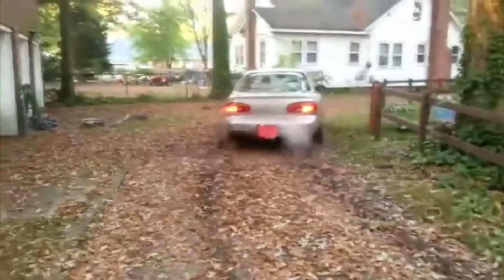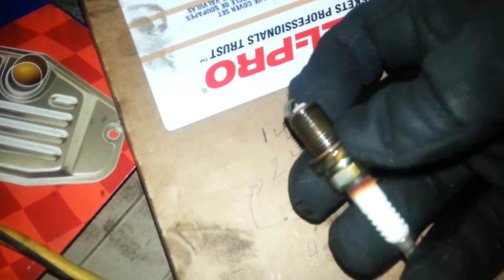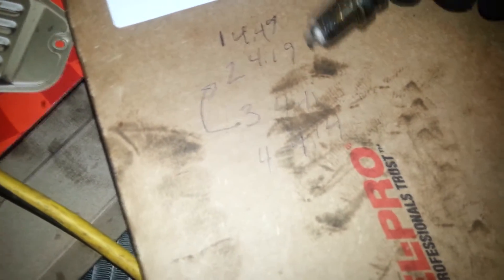Welcome to the D.E. Nichols channel. OutOfTheBottle.com. So, measure across the core — what I mean by that is measuring from here to the tippy tip of that electrode. That way you don't put in a bad one, because you can read the ohms of resistance: one, two, three, four.